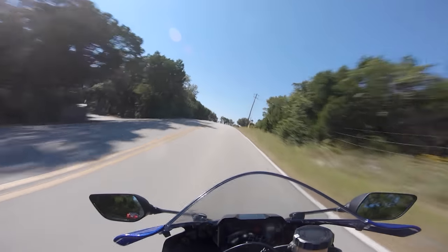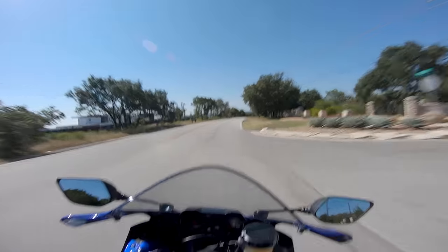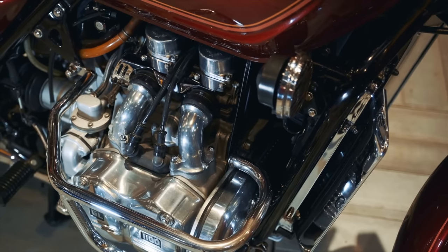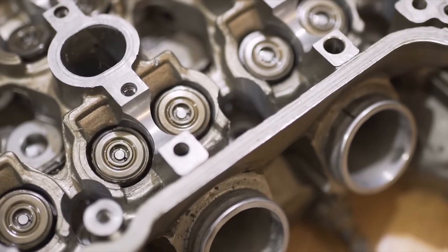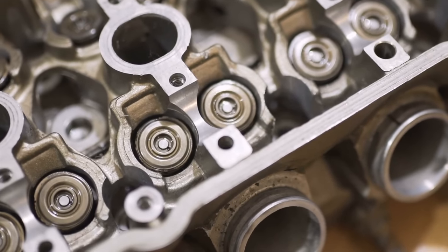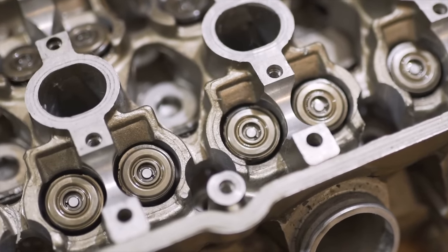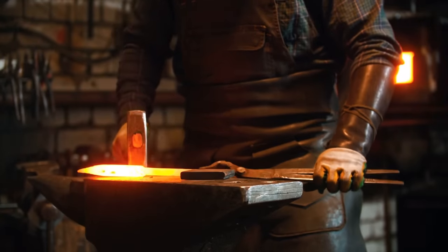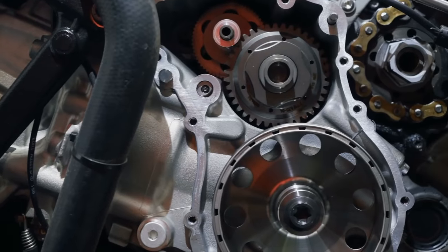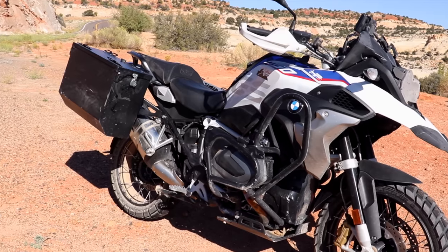It's especially important if you let your bike sit for a few days or maybe a few weeks. All the oil in the top end of the engine will slowly collect down at the bottom of the case, and while you might have a thin protective film between moving parts, it's not as thick as it normally is, allowing metal to rub against metal. That can carve scratches into the side of the pistons, rings, cylinder walls, and more. It's also worth remembering that as metal heats up, it expands, meaning that the seal between parts might not be as strong as it would be at operating temperatures.